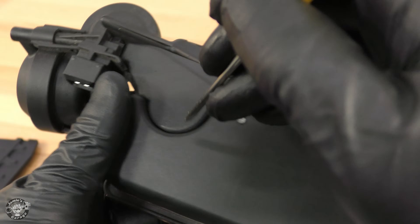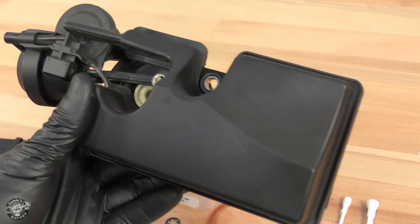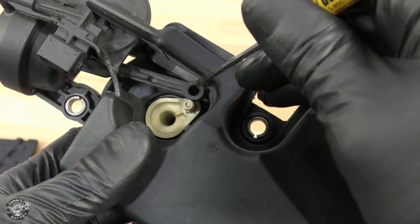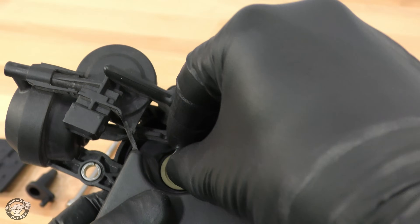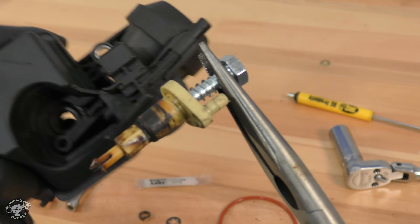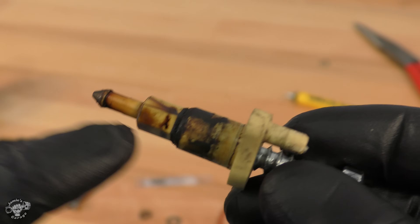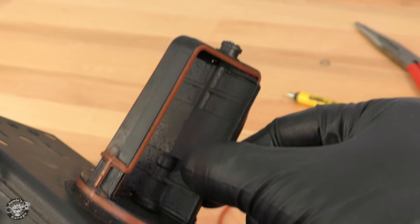Let's get started rebuilding this DISA valve by removing this cover with my pocket pry bar. That gives us access to the bell crank and the vacuum actuator. Now I remove the retaining clip and slip the actuator rod off the bell crank lever and move the actuator rod out of the way. I now use this giant screw included in the kit as a removal tool. I thread it into the plastic bell crank, then use needle nose pliers to pry it out, leveraging against the DISA housing. Now that the bell crank has been extracted, let's inspect it — this is another very common failure. The hex edges here actually look pretty good; I've seen these get completely rounded off because of plastic parts. It then creates extra clearance in the flap causing that rattling noise I was talking about earlier.